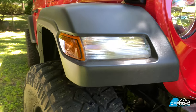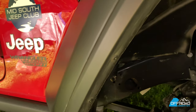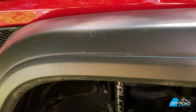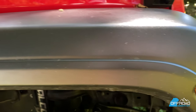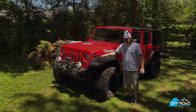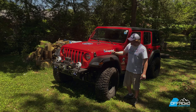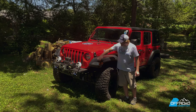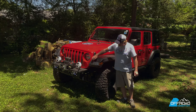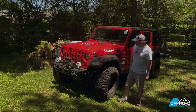These fenders are a little bit thicker than your Sahara and Rubicon fenders. The Rubicon fenders will actually be a little bit higher, but these are plastic, and a lot of the fender companies right now are getting mixed reviews because we're attaching steel to aluminum in some cases, which might not be best. That's something you need to consider if you change out these fenders. I like the fenders so far — I might chop them. It's easier to chop the Sahara and Rubicon fender, which actually separates, whereas I'll have to physically cut this if I want more room.